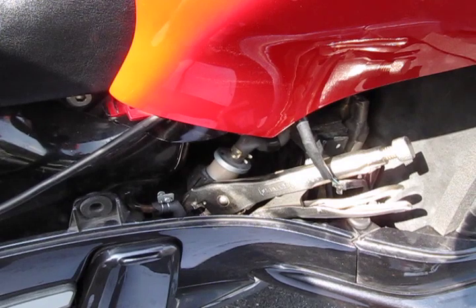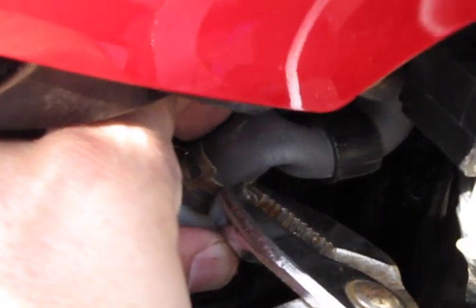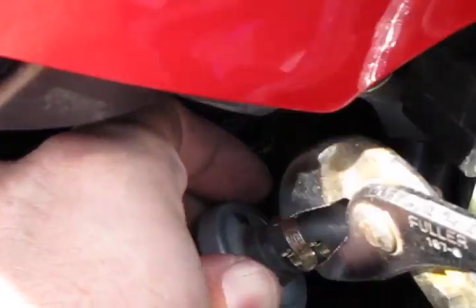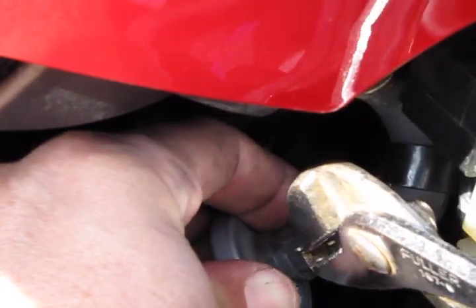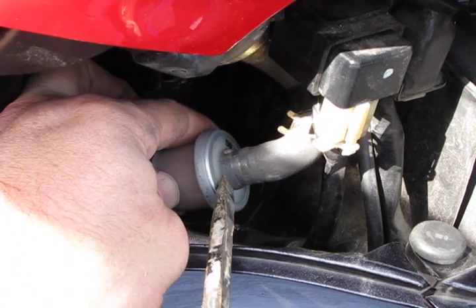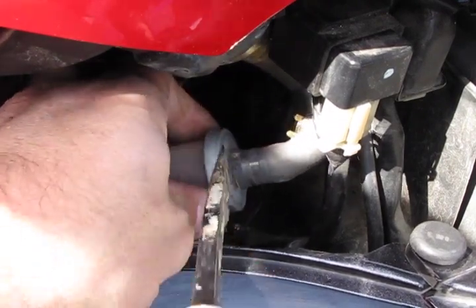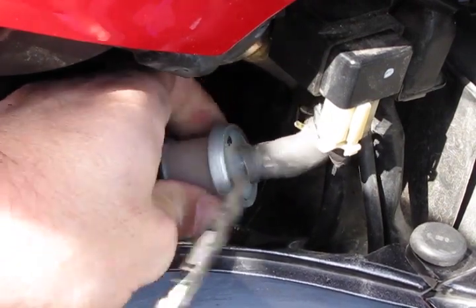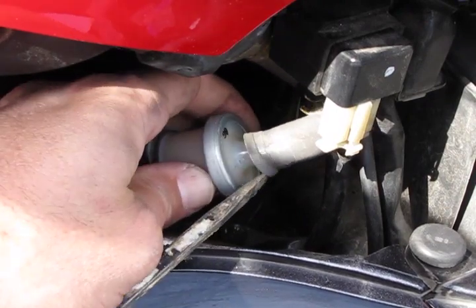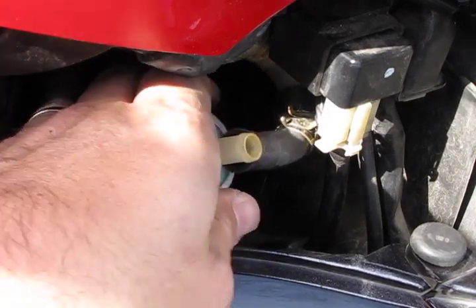With the fuel pump up and out of the way, I've lifted the fuel filter off of its mounting. Now I'm going to remove the U-shaped tube that connects the fuel filter to the fuel pump. Squeeze the tabs on this hose clamp and slide it back. Then, using a flathead screwdriver, push the hose back away from the fuel filter. Now I'm going to be replacing this hose too, so I'm not being real careful with it. When this hose comes off, a tablespoon or two of gasoline is going to leak down, so have some rags ready.